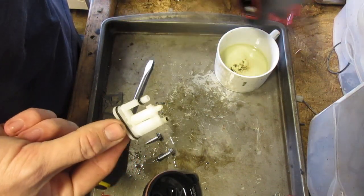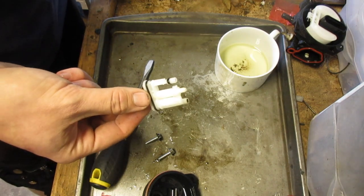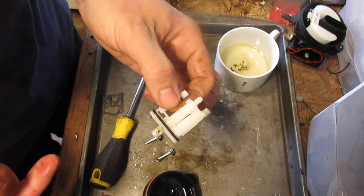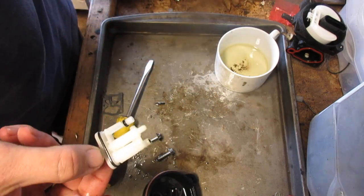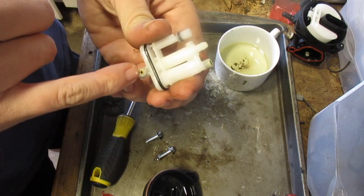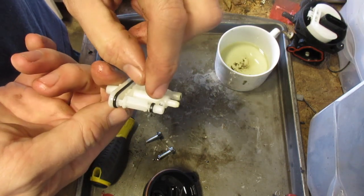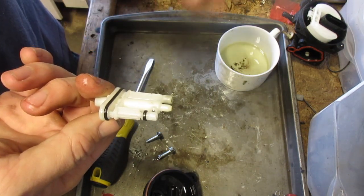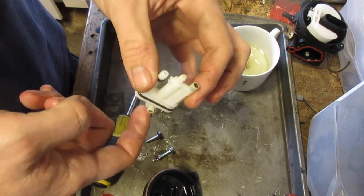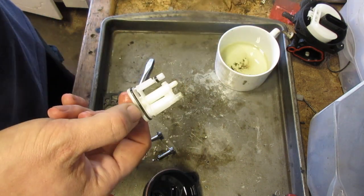And you can either replace this, which is, to be honest, not much cheaper than just buying a cheap carb on Amazon, if anything's cheaper, or take your air compressor and blow it out. To save your ears, I'm going to do that off camera. Got it all blown out. You want to blow in there, and there, and there, and there. You want to be careful, though, because there are these little ball bearings shoved in there, so you don't want too much pressure. Mine's set to like 120, but it's turned off, and I think it's pushing like 60 psi through there.